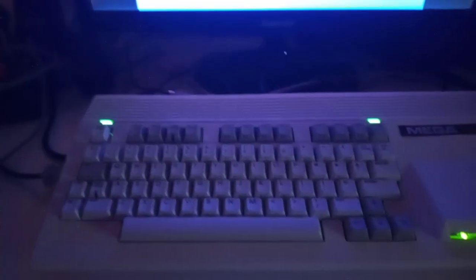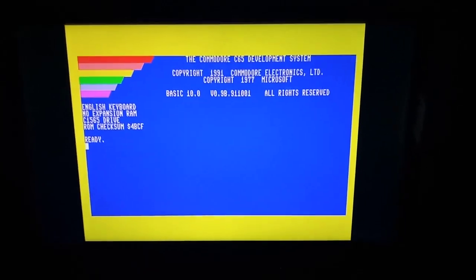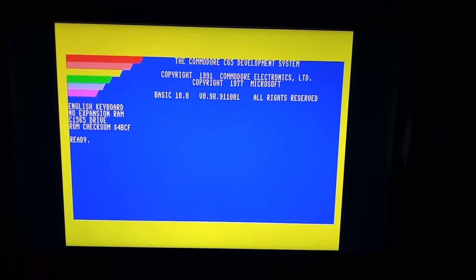And now if we watch it boot, now that it's been written, we will probably see briefly the flashing red and blue lights that indicate switching bitstream, and it boots up with the new core. So that's really all there is to do to upgrade the Mega 65 with the new bitstream.